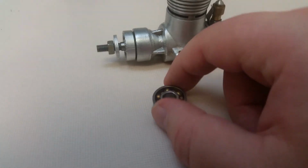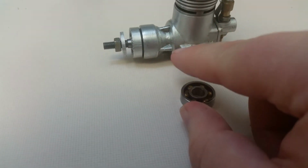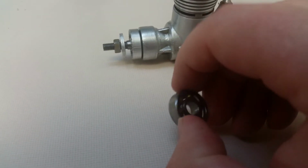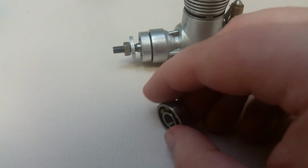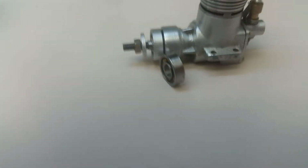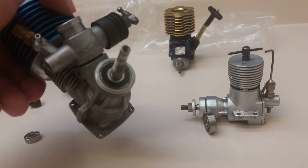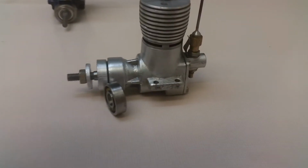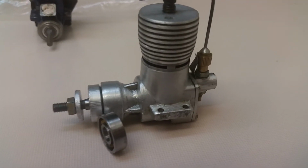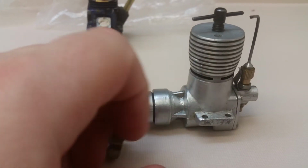If you buy 2 of these bearings the same size, it takes the same bearing front and rear. So what I'm going to do is order 1 bearing like this, open cage for the rear of the engine. Then I'm going to order a 2nd bearing that's sealed. And I'm going to pop off the 1 seal and put that in the front. Right? So it'll be like this in the front. Have a nice dust seal in there. So that'll help with crankcase pressure. Better starting, more power, more reliable. To keep the dust out of the engine, make it have a longer lifespan.